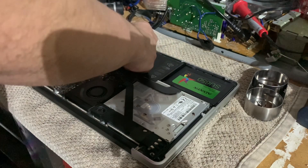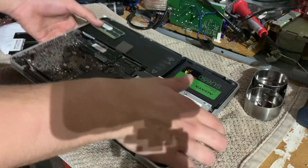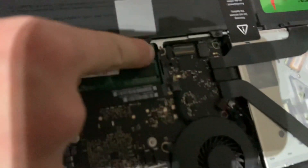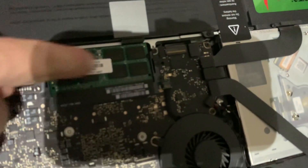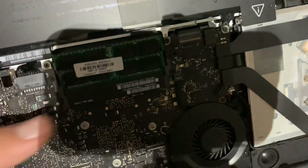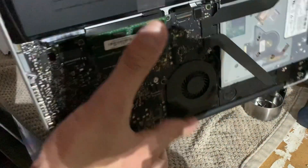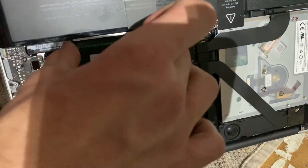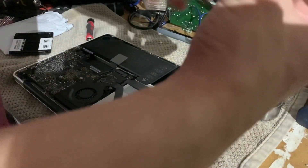If you may be unfamiliar with how to remove RAM from a laptop, it has these little slots right next to it — on this specific MacBook and most laptops. What you do is push them both apart and the RAM will pop out. It usually sits flush with the motherboard, but when you pop it out, it opens up — it's almost springy. Then from there, you can just gently pull it out from each side, and now you have your RAM sticks out.